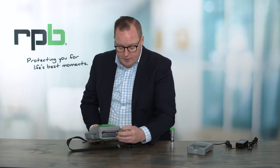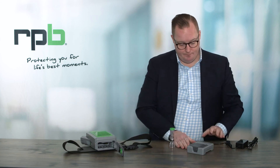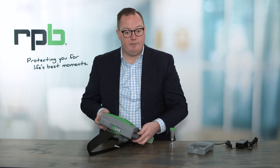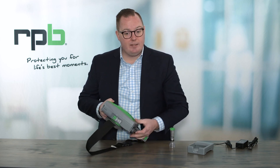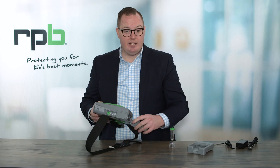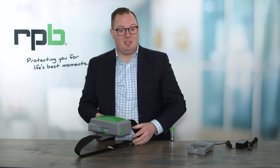To recharge the battery, you simply take that battery out of the compartment and place it into the charger. That then charges the battery — like I said at the start, it will need a full 5 hours to charge fully. You can then remove it from the charger and pop it back into the PX5. As you do that, you'll notice the LEDs will briefly show the charge that is on that battery. That is how you can tell a battery is either fully charged or is needing more charge for maximising the use of that unit.